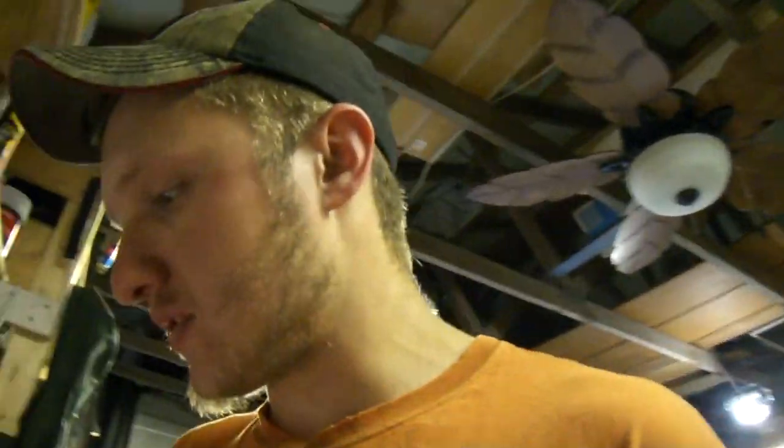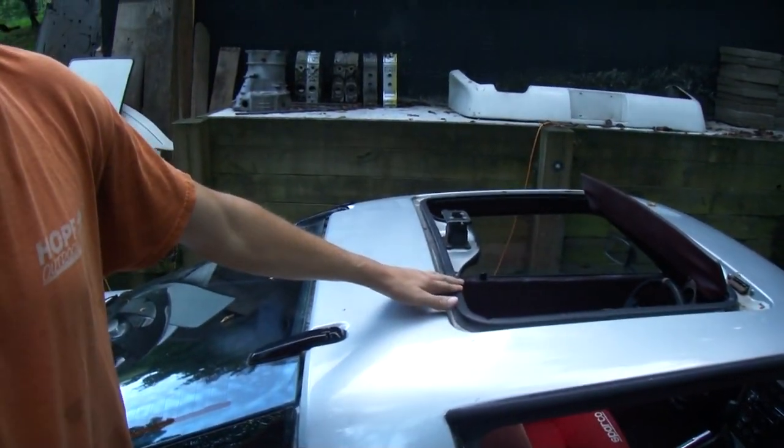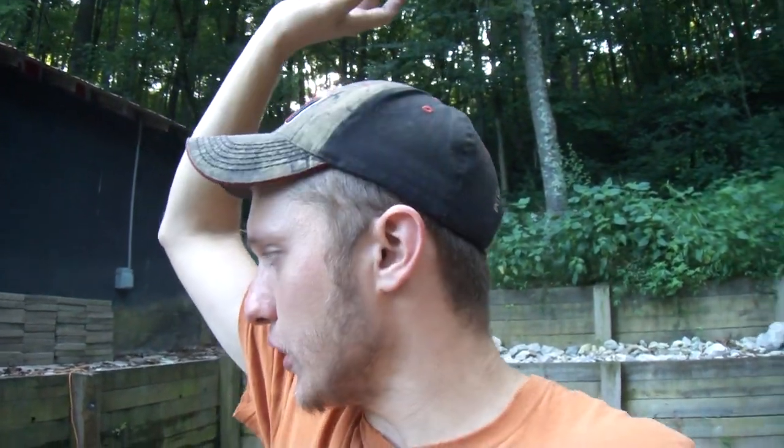That's basically it for the sunroofs. Usually it's always the spinning mechanism — you'll twist the knob, nothing will happen, and it busts out the bottom of the sunroof. If your stuff's broken and you can't prop it up, you could probably use those Harbor Freight latches, open it far enough, flip those up, and then close it so the latches rest on the car and hold your sunroof up. Do keep in mind though that at approximately 80–85 miles an hour, if it's not mildly retained, it may eject off the car. I've got a couple here that are all wrecked because they flew off the car when we were trailing at home.